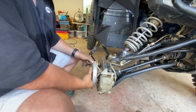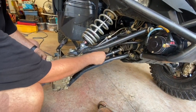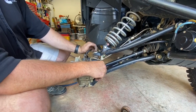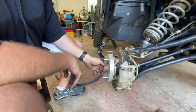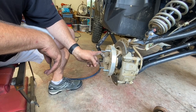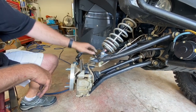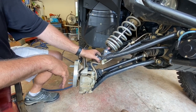So as you can see, we got the wheel off of it. Just a couple of pieces to identify — this is your axle, and you can see in this case that this one's broke. We're going to pull this axle shaft out. In order to do that, we'll have to take loose both the upper and lower ball joints, take the tie rod off the spindle, and take the cotter pin and nut loose on the hub. We'll also have to take the lower shock mount loose from the upper control arm, tie it up out of the way, and then we should be able to get this axle pulled out and start putting it back together.